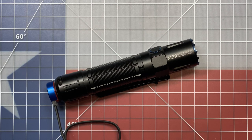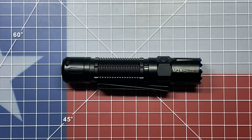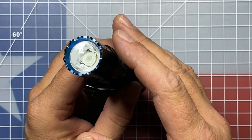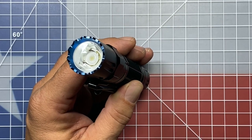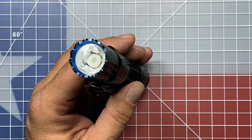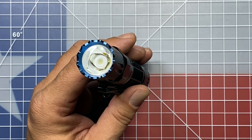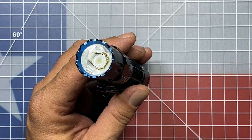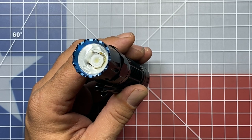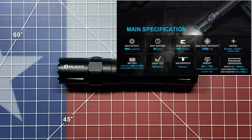Let's go over some of the features of the Olight M2R Pro Warrior. First of all we're going to start with the emitter — it's going to utilize a Cree XHP35HI emitter, and that's going to provide you with a slightly warmer tone than most flashlights in this class; it's a little easier on the eyes. They combine that emitter with a TIR optic lens, which is going to provide you a fairly large hotspot but also a generous amount of flood — it really does strike a good balance between the two. This flashlight also carries a 1.5 meter drop rating and is IPX8 waterproof rated as well.